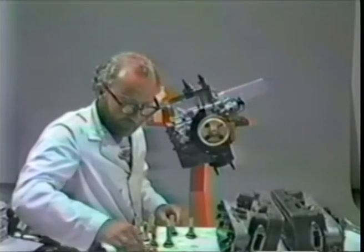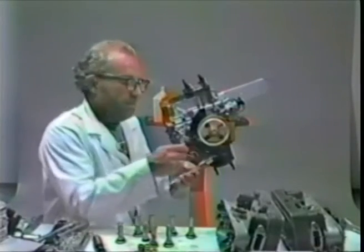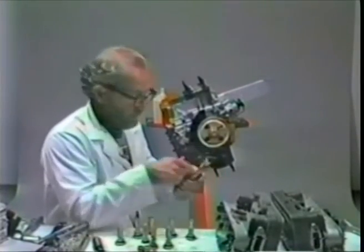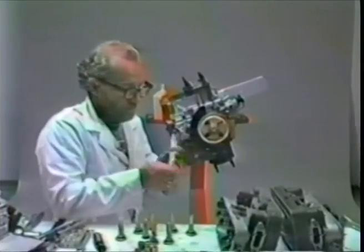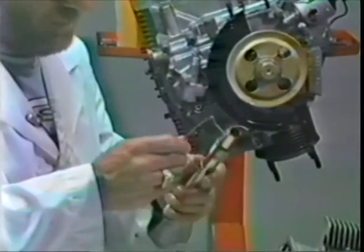Okay, we've got the O-ring seals on everything. Grab 2 pushrod tubes that you like. Put on the clips that hold the air deflectors in place. They just snap on. They have a little semicircular piece here. Make sure you put them on the end that has the extension on it, like so.